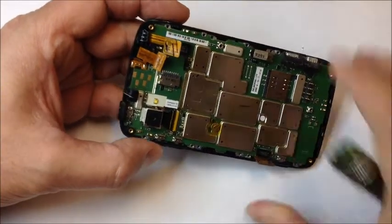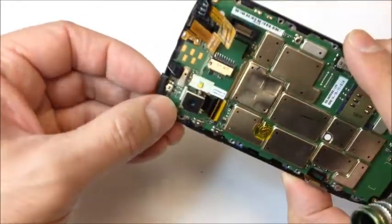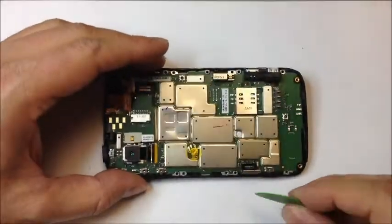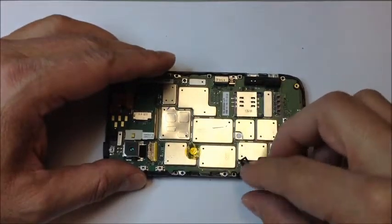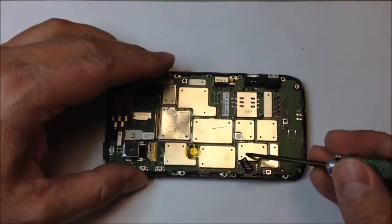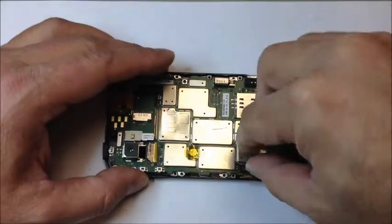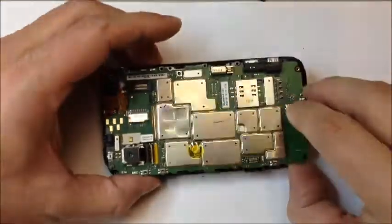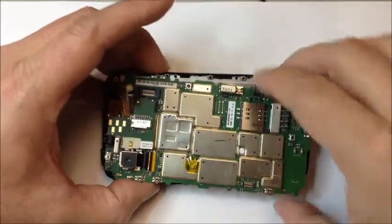You just have to get the board out from under there. Take a pick and go underneath. You can see another little gasket that popped off from the connector — set that aside. You'll want to put it back in before you reassemble the phone. It's a good design by Motorola to keep moisture from collecting inside, especially under the flex cable.